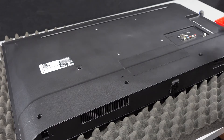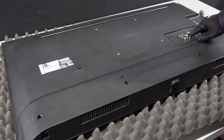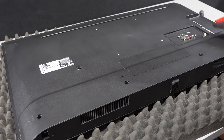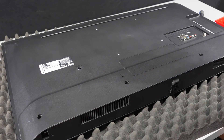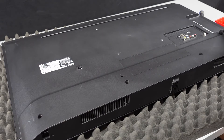We've already removed the screws from the back of this unit — there's only eight of them. It looks like four along the bottom, one on either side, one in the middle where the main board is, and one over here to the right. Once you have those removed, these clips are going to be a little bit tight. Best course of action: use a spudger if you've got one. If not, a flathead screwdriver — just be very gentle. We're just going to find a good point where it separates the back from the front of the TV.